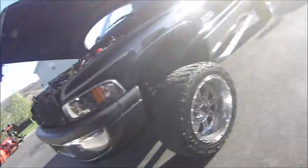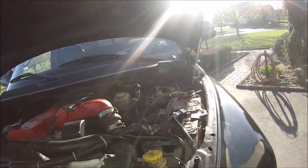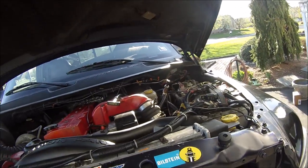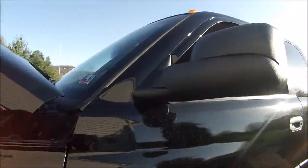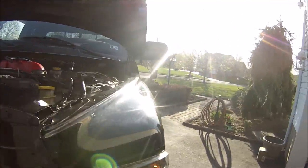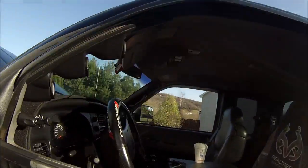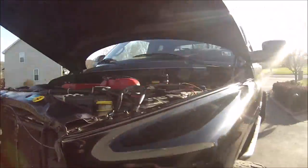So we made some progress yesterday with the truck. We got both of the low beams working, and one of the high beams working. The relays weren't supposed to show up until tomorrow, but I come home and look what I see — LMC Truck box, baby. So I'm going to go ahead and replace these relays really quick. Just to show you guys the current status of the lights — low beams work, work, work, work. But when I turn the high beams on, one doesn't work and the other works.